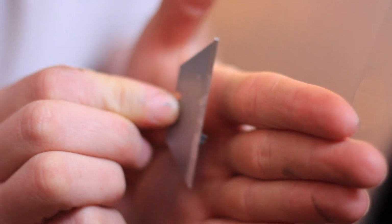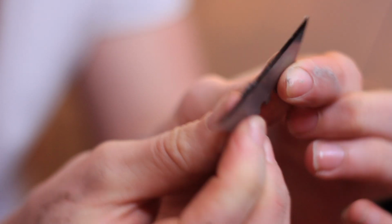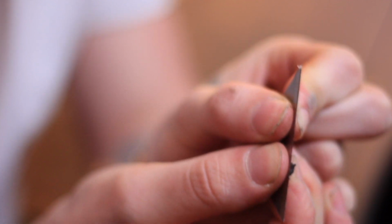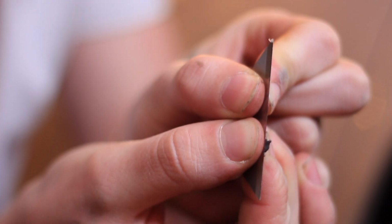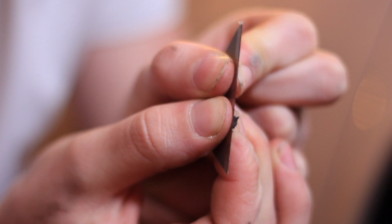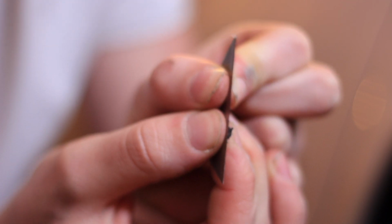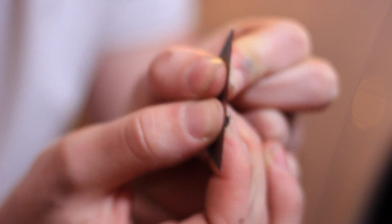One thing I highly recommend when you're dealing with your razor blade is rather than just holding it like this, if this is your door, and going like this, you want to put your fingers behind as thin as you can, just get your fingertips, and rest your fingernails against the door like this. So you're never getting too deep. You're making sure you have a guide and you hold it up near the blade, and then you're going like this, very gently, very careful, so you're just getting the adhesive and not scratching your car. Because that is the most important part. This is free, but you could totally screw up your door in an instant if you're not careful.